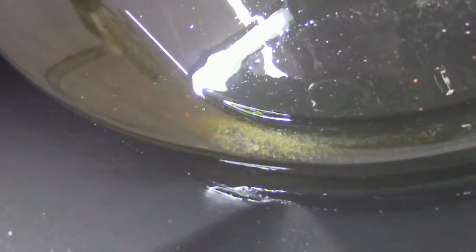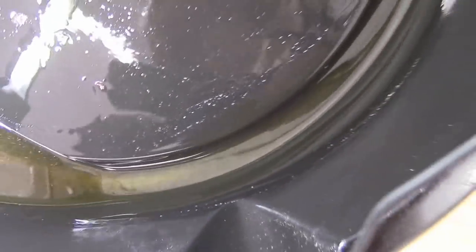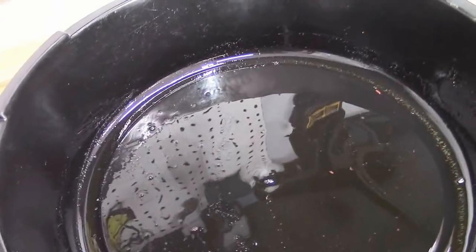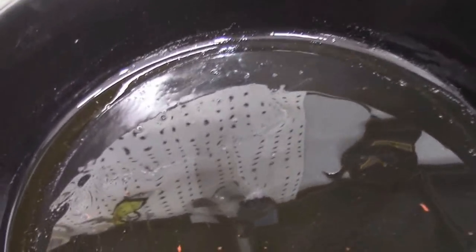How many times have we seen this on the channel? There's a really good view right there. All those metal particles in that little bit of differential fluid. That differential is toasted. We have seen this both with transmissions and engines, probably more than a dozen times on this channel. But it is curious to me how clean this fluid looks otherwise — I wonder if they tried to change the fluid or something, because they suspected this is a problem. I don't really have the whole story on this. I just only have the symptoms, but very often after I dig more, you guys have seen this too — you find more information from the customer as you look into it. It explains that stripped bolt to drain the fluid as well as why the fluid looks clear other than all these metal particles floating in it.